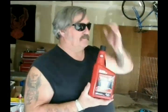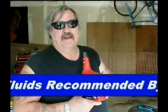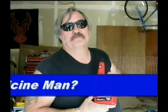He came up to me one day and said, "Hey, are you using Marvel Mystery Oil?" And I said, "No, I'm not." And he goes, "Well, here's what you got to do. Your bike will run like a champ. Just put a shot glass of this in the tank when you fill up, and put a shot glass in the oil when you put the oil in." Now, when Scott tore my motor apart at 100,000 miles, and I did this pretty religiously, what he said was there's nothing really wrong with this motor. It's just got some normal wear and tear, but nothing extreme.